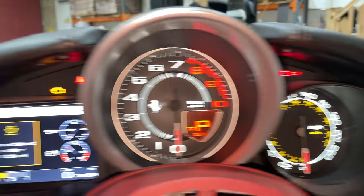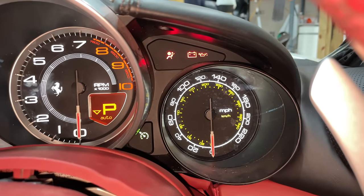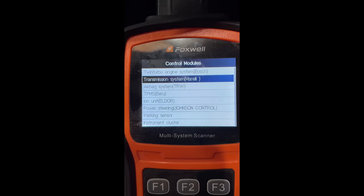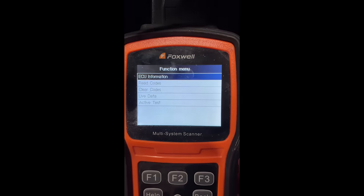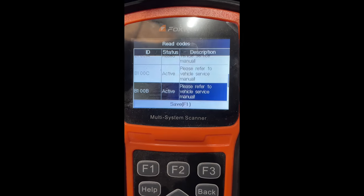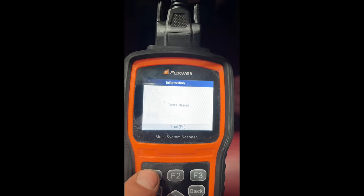I'm going down to Cali 2 which is the F149. We've got a few codes on there — I think these will all sort of stay there for now until I start the engine. I'm going to try and clear the codes and hopefully the airbag light will go. I don't think the airbag light will go now because it's all part of the same system with the seat belt tensioner and I haven't had those reset yet. Going to control modules, airbag system — read codes. Active, active, active, active, miss, miss — those are the ones I'm trying to clear.